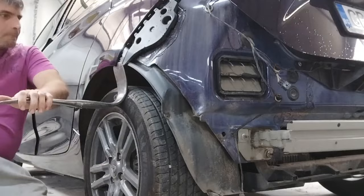The color is wonderful, purple pearl. The structure of the original paint coating is very characteristic of these cars, and I choose to spray the base with a gun that sprays more finely. It does not depend on the size of the nozzle or on the spraying itself. The SATA HVLP, which is a wonderful gun for cars, Mercedes and BMW, is not very suitable here. I will spray with Iwata Bellaria 1.3.